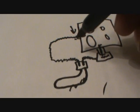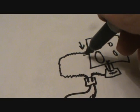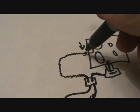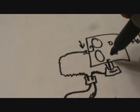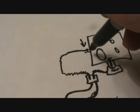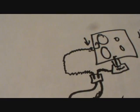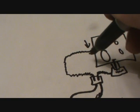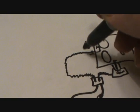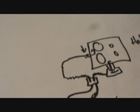Now, I said leave this open to the atmosphere. You really don't need to leave this open to the atmosphere, because it's being sucked into the engine. So if you couldn't find out where it goes, had a different carburetor or whatever, and just couldn't find the fitting, then take a little piece of foam or something like that and glue it on the end of it, and you can leave it hang out, as long as it has some sort of filtration. You don't want it to suck dirt through that system into the carburetor.